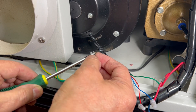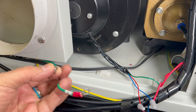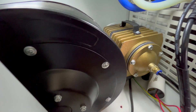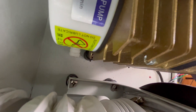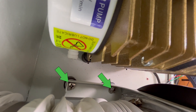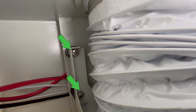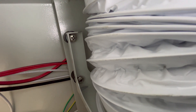So I go back to the other side and disconnect the grounding cable from the exhaust fan itself, unscrewing it and setting the screw aside for later. Now I go inside the tight area where the exhaust fan is housed. You can get a better look at the 90-degree frame bracket as well as the mounting screws and the rubber mounts. There are two screws on this side with washers and lock washers that screw into the mounts, and two more screws with washers and lock washers on the other side.